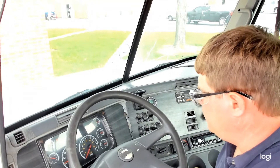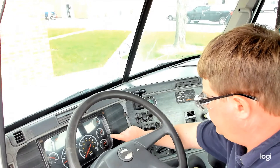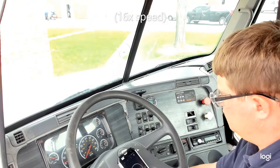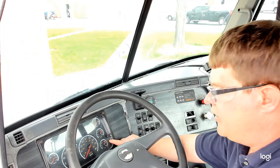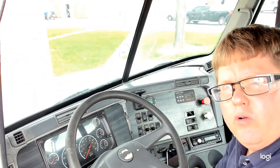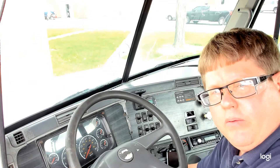We just reached Governor Cutout. We're going to apply our brakes — full brake application — and we'll start our timer. We want to make sure that stabilizes and start our timer. My foot is still on the brakes; I didn't move it. I've kept it pressed to the floor. Our 1 minute's up. We definitely had a significant air loss there. It looked like our secondary gauge started at about 115 PSI, and at the end of 1 minute, we were about at 105. The primary looks like it was at 110 and maybe ended at 105. With the secondary gauge alone, we definitely exceeded that 4 PSI per minute limit, and this would fail. It would be important then to figure out the source of this air leak. I do already hear an air leak coming from the dash, but you can get a helper or apply a brake pedal depressor and look around the truck to find out where the other air leaks are to determine the proper fix.